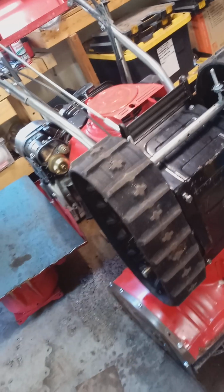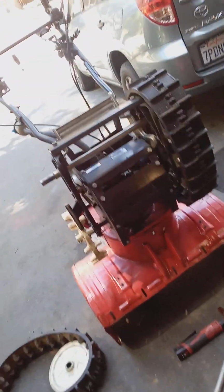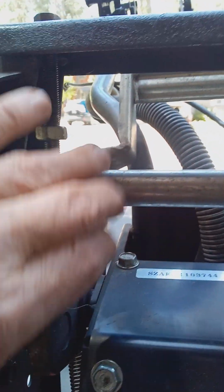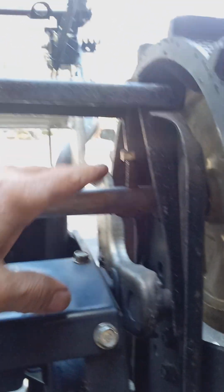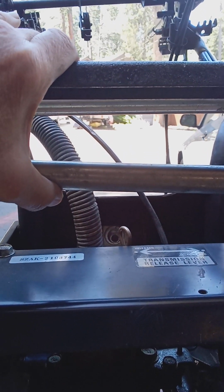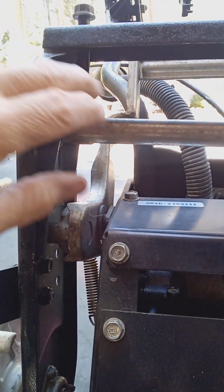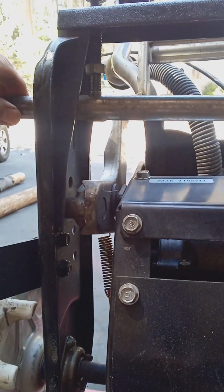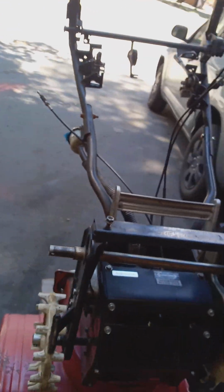This should help you save money if you have to replace a track or adjust a track. It's a pretty common issue with some people. Last winter, I saw 3 or 4 of these studs broken. After 20, 25 years, sometimes they'll break. And like I said before, you can use a clamp in an emergency and clamp it so that your track stays tight until you have the time to replace the stud. And like I already showed you, it's just time consuming. It's not too difficult. I think anybody can do it with a little bit of patience.